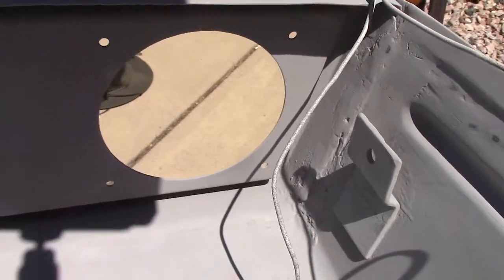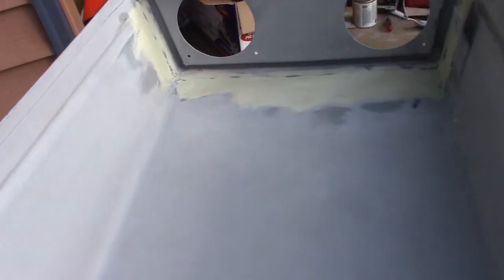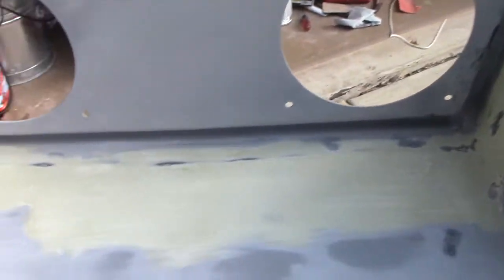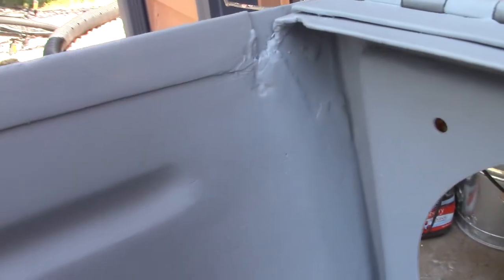I realized there were several spots on the underside that needed a lot more attention, so I got out the heavy-duty body filler and got it on there, then sanded it down. Then I put a little glazing putty into the low spots. On the other side I put body filler in to smooth out some of those ragged lines, sanded that down, and there were a couple of spots I could see would be a little low — so I got it primed again and re-sanded.